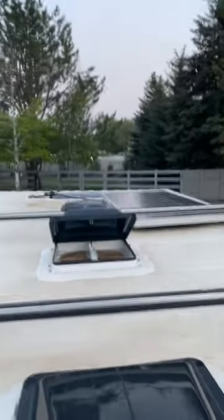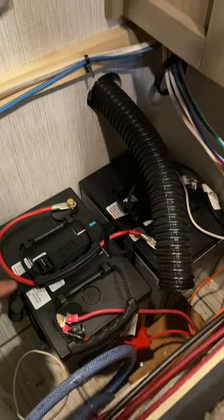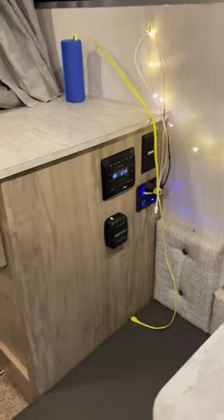Also got an extra solar panel up there, upgraded batteries, and upgraded the solar charger to maximize charging of the upgraded batteries. These are dual 6-volt AGM — those are awesome. Never run out of power since I put those in. Everything's run beautifully with just solar recharge.